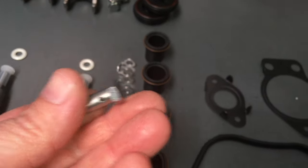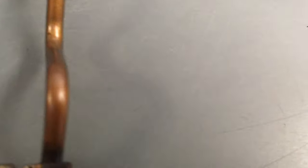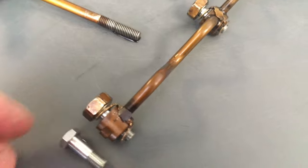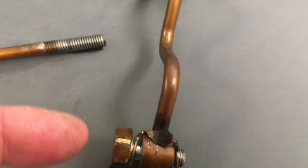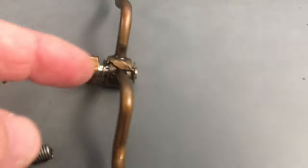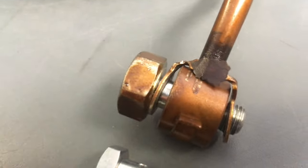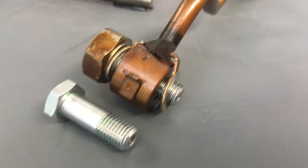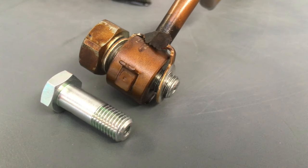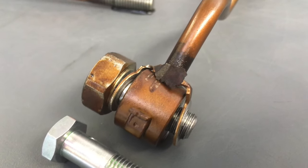Let me take these bolts next to the other ones and compare so you know what I'm talking about. If you haven't already, please hit pause and go and give us the thumbs up, make sure you subscribe and turn the bell on. Now I'm going to put this one down next to it to show you what I mean. This is a factory job we've removed and you can see it probably twisted when we undid it - you can see the way it's turned. So look - from factory generally they're not twisted, but see how the head is really big underneath? It only takes a small burr, anyway. That's the old one, that's the new one - they've redesigned it. All the ones I've done, those washers twist a lot with these big-head bolts. Even if you clean them, polish them, put oil on them.